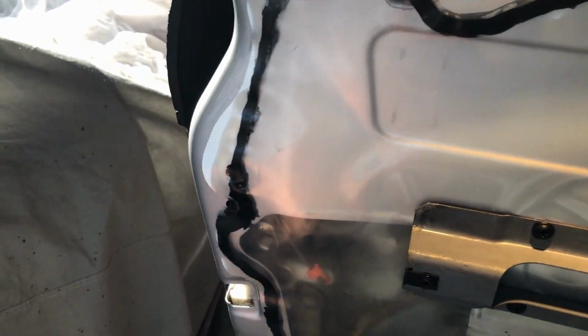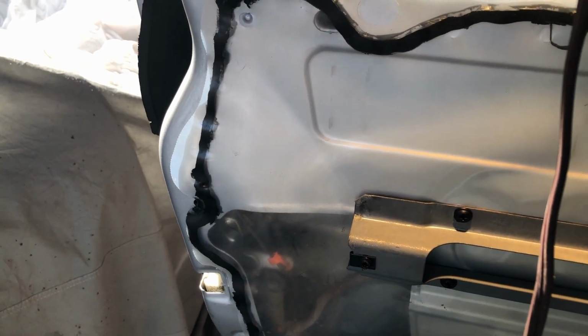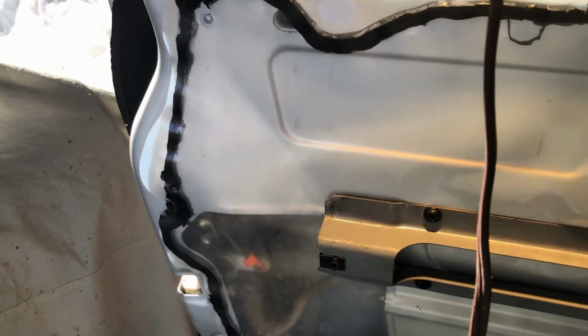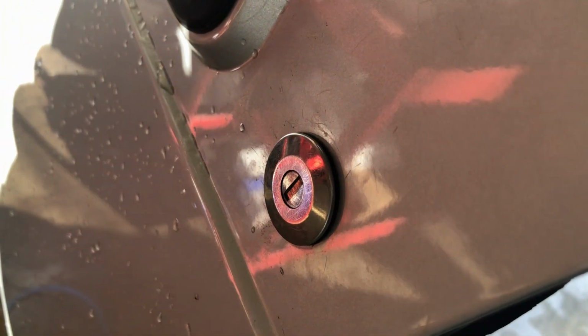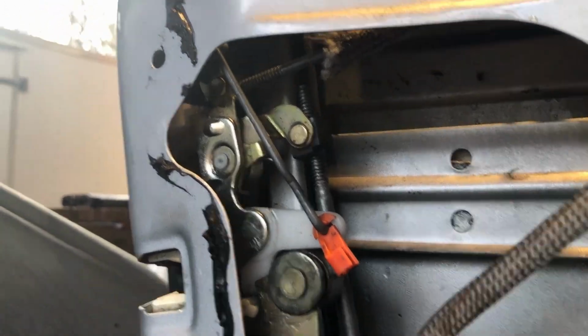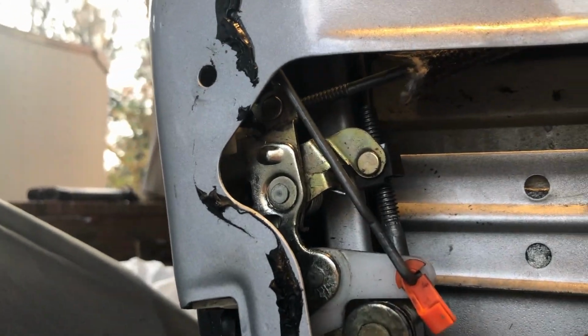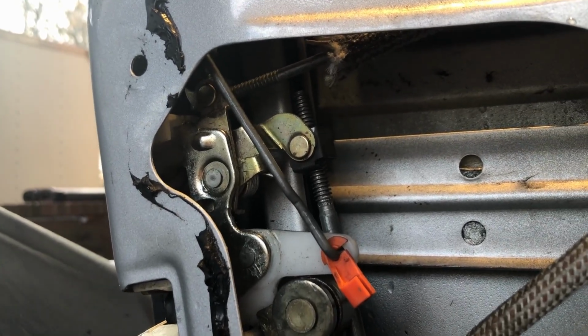Freely, no issues. So then that process of elimination says there's a binding in this section in here. So that's why I went ahead and disconnected it, checked it, and came to the conclusion that it actually was the backside Z-shaped locking mechanism piece on the cylinder. So, when I say gotten loose, the backside of the key lock mechanism is loose.